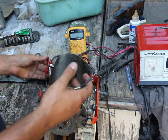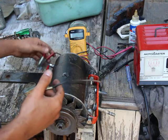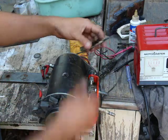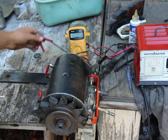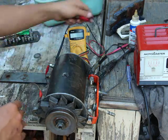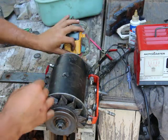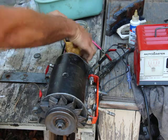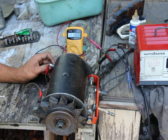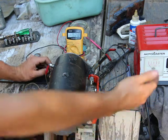Now for the second test, I'm going to disconnect the A terminal — that's the output — and just connect the ground here. If it's connected by itself, as you can see nothing happens because it's not completing the circuit. The other terminal connected to this voltmeter, set it to 20 volts. Hopefully you guys can see the voltage. And the other lead I must connect to ground. So as is we have 11.5 volts — 5.5, 5.4. That's as expected because this is a 12 volt battery charger.